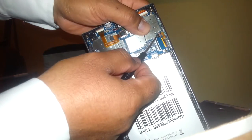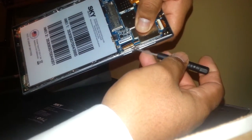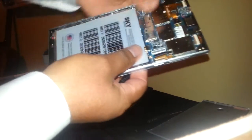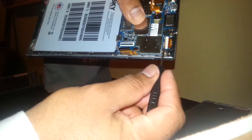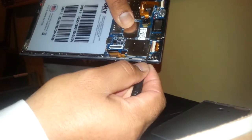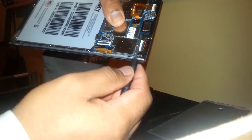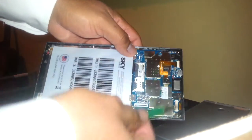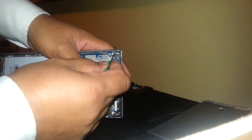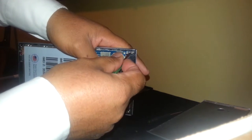There is a black side — just lift that one. It's lifted. Be very very careful pulling this flex cable out. Now we are going to disconnect the touchscreen digitizer flex cable — this brown side — just lift it. Remove the flex cable very carefully; don't force anything. We can leave the camera for now and do that later.